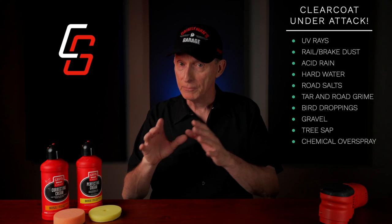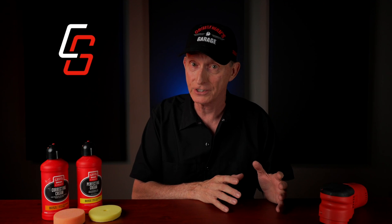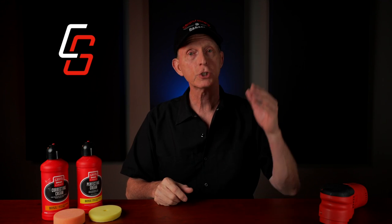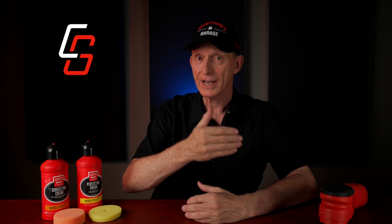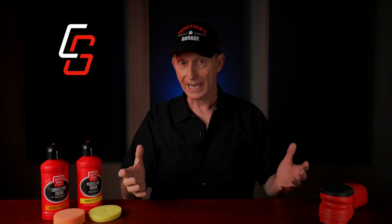In addition to environmental elements, as if that wasn't enough, the clear coat can also be pretty easily scratched. The clear coat is relatively soft, and many clear coats can be scratched with nothing more than your fingernail. Just washing and drying your motorcycle can scratch the clear coat and cause swirl marks in the paint. Light scratches and swirl marks are much easier to see on dark surfaces, with black being the most obvious. A white or light-colored surface won't show these scratches or the swirl marks as easily, but that doesn't mean they're not there. They're just harder to detect.